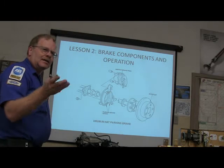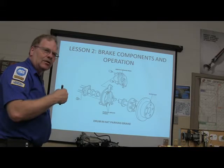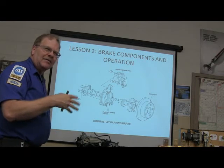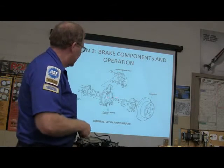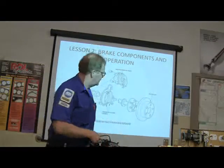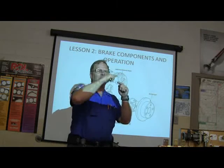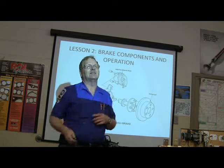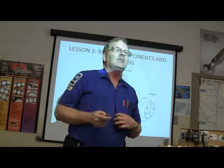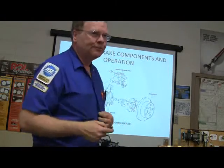Trucks. Late model Chevy pickups have it, right? Yeah. Also, your Crown Victorias have got it. A lot of the Fords have got these. These little park brake shoes, though, when you're doing the rear brakes, like on a Chevy pickup, it won't have two shoes. It'll have one shoe that's in one piece and goes all the way around and has to be changed. And just about every time you do the rear brakes on one of those Chevys, those park brakes will be worn out and you need to replace them, too.